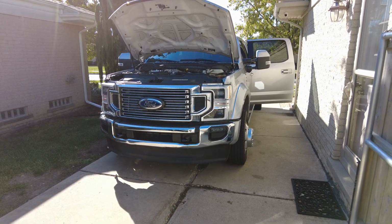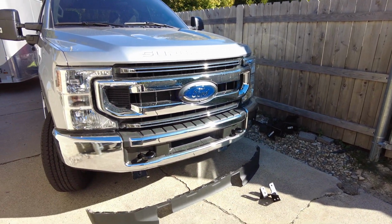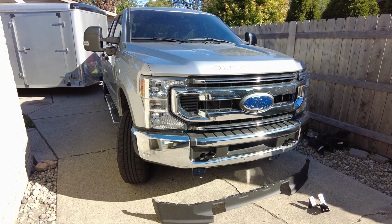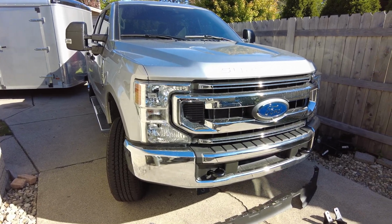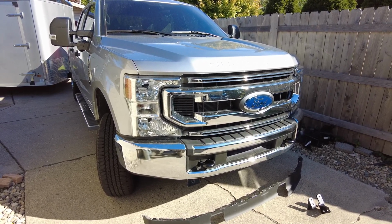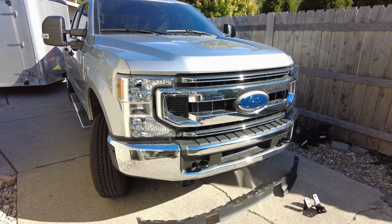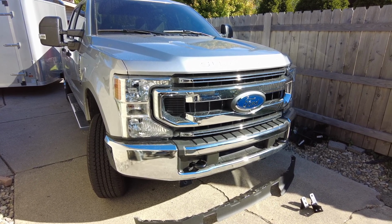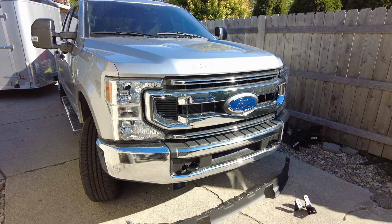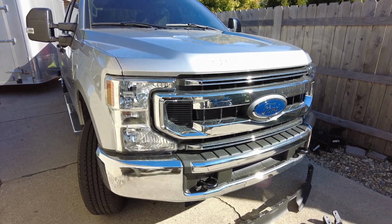Now, the diesels idle pretty efficiently because on a normal gasoline engine like what we have here, say you're going to idle this thing, it has to run at a lean rich threshold of roughly 14.7 parts air to 1 part of fuel. So it has a set determination of how much fuel it's going to burn, being a port injected engine. If it were a direct injected engine, it could idle much more efficiently because the fuel is injected directly into the cylinder. The lean rich threshold of air to fuel ratio could be anywhere from like 40 to 1, 40 parts air, 1 part fuel, instead of just 14.7 parts of air to 1 part of fuel. So a direct injected engine can idle much more efficiently than a port injected engine.